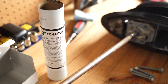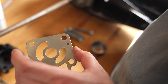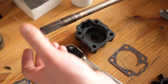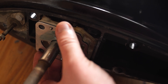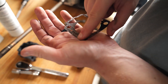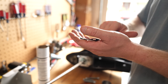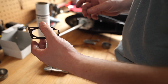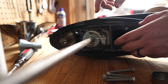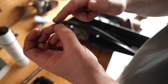We're going to get a little bit more grease and throw a little bit on the top of that gasket. Before we put the guide plate on, we're going to throw a little bit of grease right here in the center where the impeller is going to ride. Now we're going to slide the guide plate on and grease the next gasket up. Now that we've got both sides of this gasket greased, we're going to go ahead and slide that into place. These guide pins are going to make sure you put these gaskets in the right orientation.